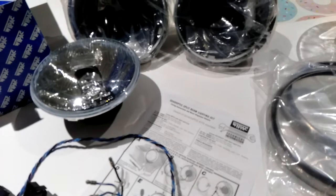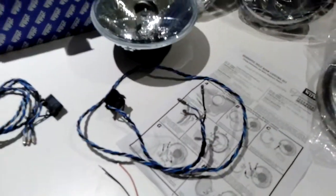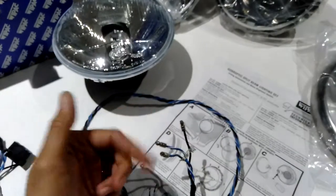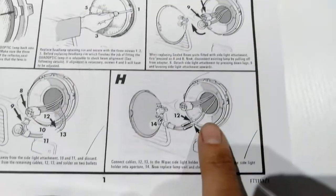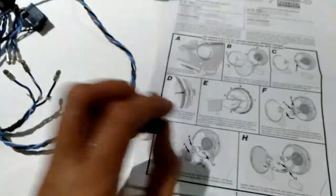And the way the park light needs to be wired in there too. The way it needs to happen is that, if you can remember, and I'll point out again when I get back into the car, the connections for the headlights, which are just near the front grille, there's a separate red wire for the park lights, and that's why I've got this extra rolled wire. So I need to wire that in. And the way it works, I'll just show you on these instructions here, because these are actually pretty useful. So that picture there, that's how I need to wire it in. So that's using one of these lights. They came with the headlight kit.